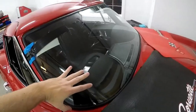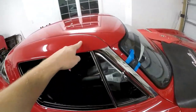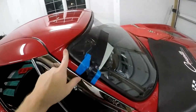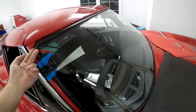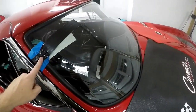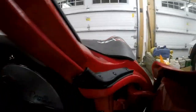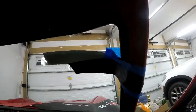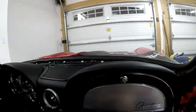I took off all the inside trim for the windshield, sun visors, and the rear view mirror and set them in the back of the car. I had to loosen the pieces of trim that go across here, and on that side I had to loosen the corner to move that piece around because the one on the front clips into it. I put a little bit of duct tape on the windshield to make sure whenever I'm working it out it doesn't flop out. Now I plan to go in with my pick tool to peel back the rubber and kind of push it, then start to push the glass back out.